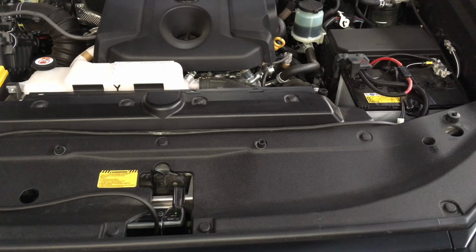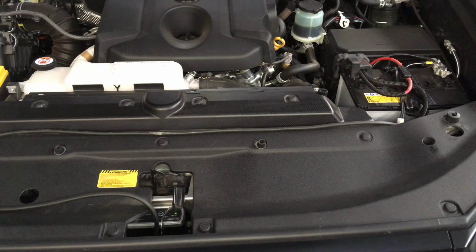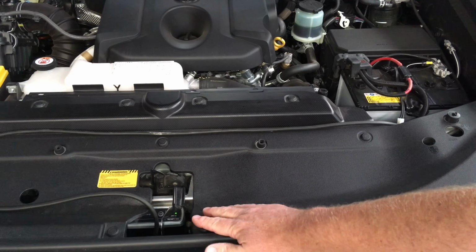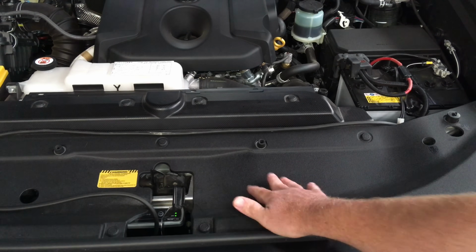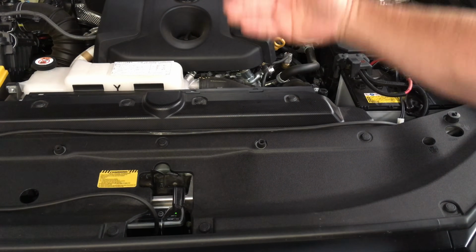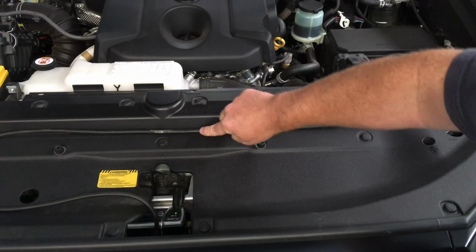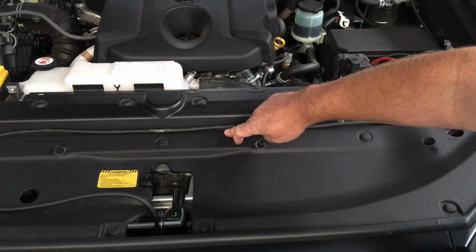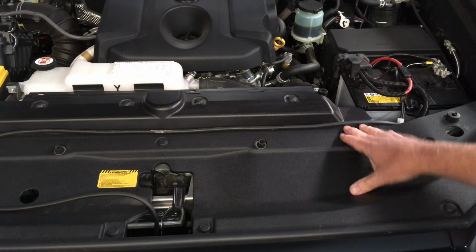Anyway, okay, that covers the clips. You've got the part numbers, that's the 150 Prados. A lot of these clips are used other places in the car as well. But the important part I wanted to say, which I touched on at the start on the 120, is this panel: take all the clips out, it's not going anywhere. Once you shut the bonnet latch, it's locked down. The rubber seal comes down and sits along the top there, right where that solar charging wire is sitting at the moment. It sits there, so it's locked in, it's not going anywhere.